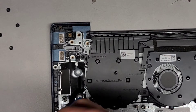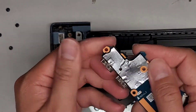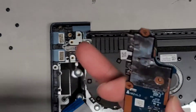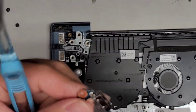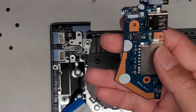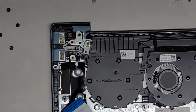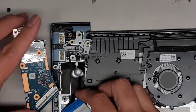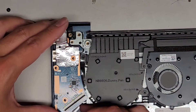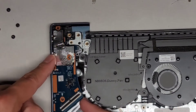Try to make sure everything is lined up right. Stick that back together. This all looks okay — I'm going to brush it off just in case. This is also the power button here, so if your power button's fried keep that in mind — it's right there. We can actually go ahead and put this back in because it looks okay. You might have to put it at an angle to get the USB ports in and then drop this down — make sure these little raised notches go in the right way.